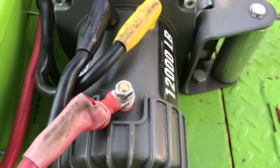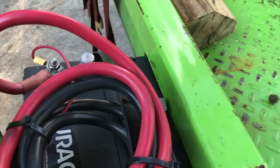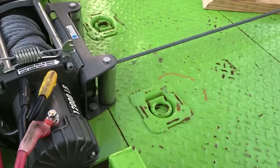That's all torn up already — I have to get another one for that. Then they run over there to the battery on the trailer, and the battery on the trailer has a charge-back which goes through the harness to the truck, so the truck will charge the winch battery back while we're going down the road.